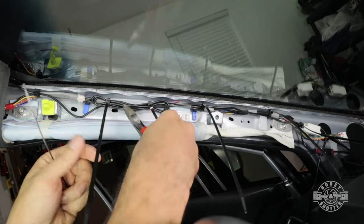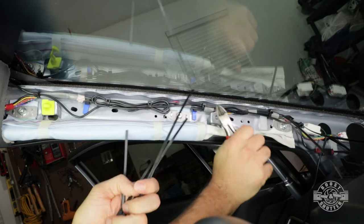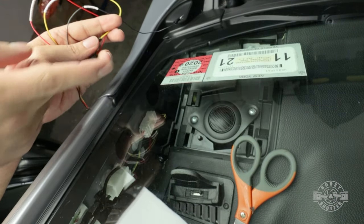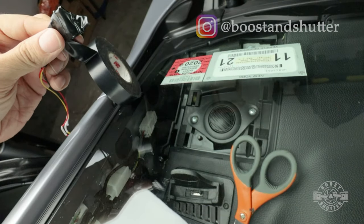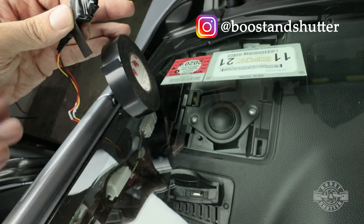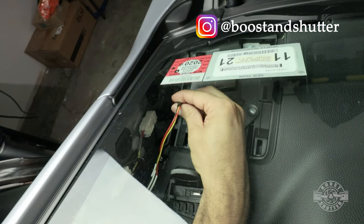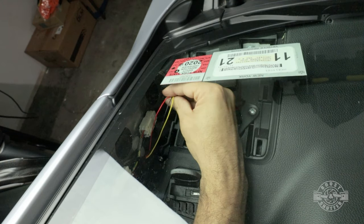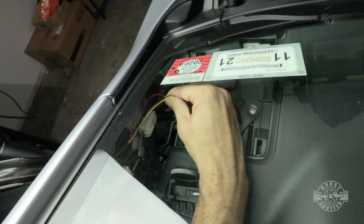So the rest is fairly simple. Every few inches, secure the cable with a zip tie and then trim them when done. To get to the fuse box, we have to run the cable through this gap right here, and there isn't enough room to put a camera in there and clearly show you. To make this easier, you can do two things. First, wrap the individual wire ends together so that there is less of a chance of them getting caught on something, and it might help to flash a light from underneath to better see the paths that your cable can take. I've done this a few times and it can be challenging, but definitely doable.